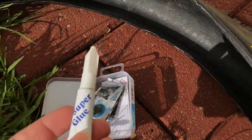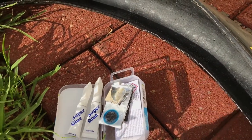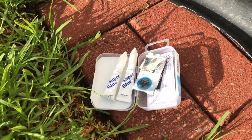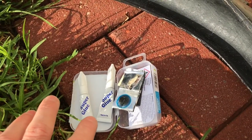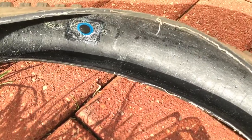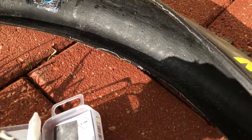You should use rubber cement — tire cement — which is what every patch kit has come with since the 80s or 90s. I don't know why they've gone with super glue, but it doesn't work. It's terrible. I patched it initially and it was no good — as soon as it cracked I could peel the whole thing off. It was done.